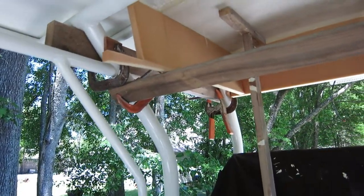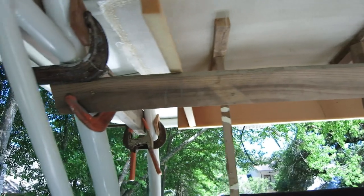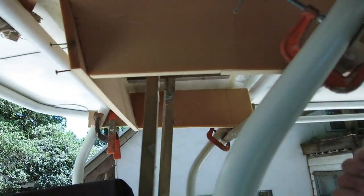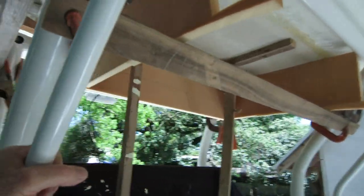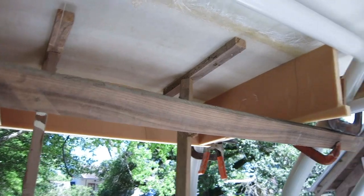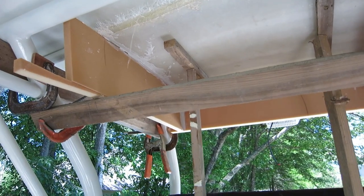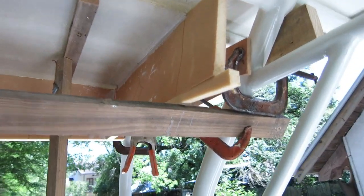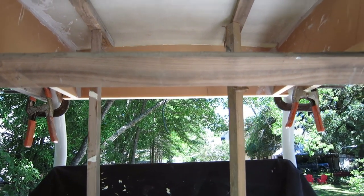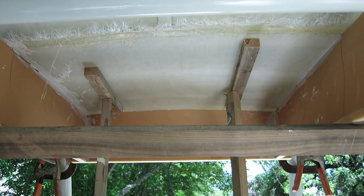Sides are cut and fit and I have a plan of action to hold them up there. I'll put another horizontal a little bit low so I can put a little wedge — I happen to have some wedges left over from the foam in the front. I got a couple of screws just barely started, and I'm going to run them in when I get the pookie on there. They're obviously over-long in the back and the front is over-long on the sides — that's okay. I can trim them after everything gets hard, the thing gets rigid, and I can take it down and glass it in the shop. The two sides are up there — kind of a challenging reach — but they have enough thickened resin on them so that in a day or so I can get all these braces out of the way. Then I'll just have to put the back and the bottom; once the back's on it'll keep its shape and the bottom I can do on the workbench.